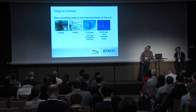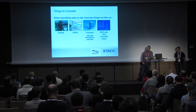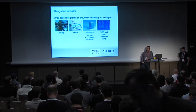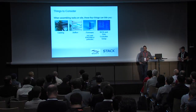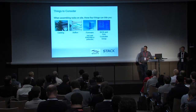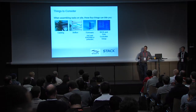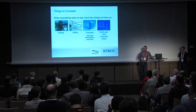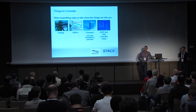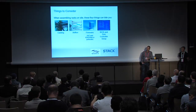BIOS is another big area where people are still going through and manually changing settings on machines to make sure everything matches up. That's not the right way — human error is the cause of a lot of problems. The best thing you can do is get your golden sample, get it set up, dump a bin file off, and flash that to every machine as it comes through during your testing and burn-in process. It'll save you a bunch of headache — you'll know every one is always the same.